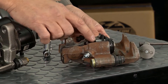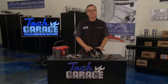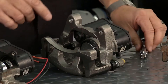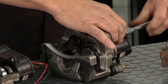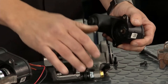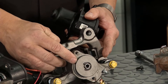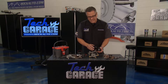Still important because you have a gear drive mechanism system here. The new systems — this is pretty cool because this is the electronic brake. You may run into a scenario where you just have to replace the motor or just the caliper. Maybe the motor's working fine. You can actually separate this unit right here. I have the bolt off on the other side and once I separate it, you can see two things. First, this O-ring seal — make sure this O-ring seal is on the new motor or is replaced because you don't want any dirt getting into this motor. It's a motor, it's a mechanism — it's going to cause problems.